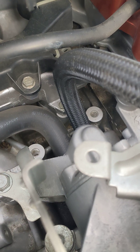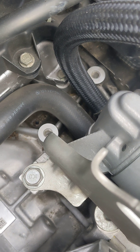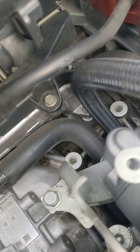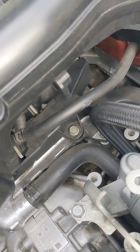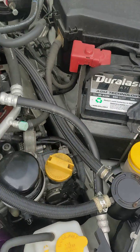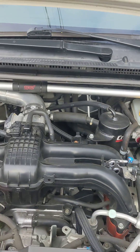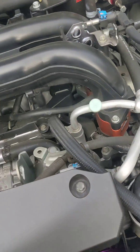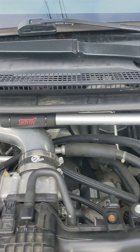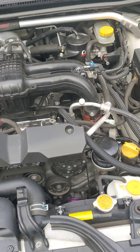This one — I've read that when you do a lot of engine braking, a lot of air gets forced out of this breather port, part of the block. And that air needs to go somewhere. In racing applications it would probably go to atmosphere, but for emissions purposes in regular passenger car vehicles, that blow-off air is going to go back into the intake and then through the intake manifold to be burned.